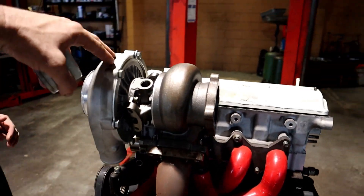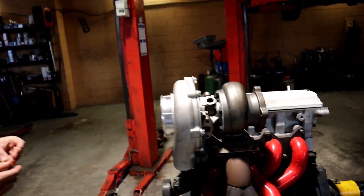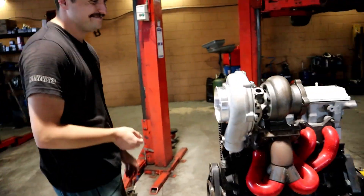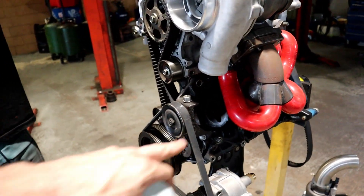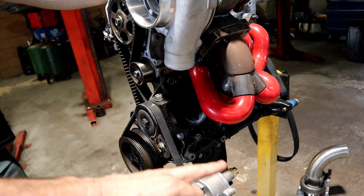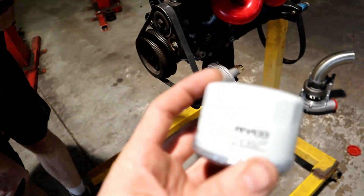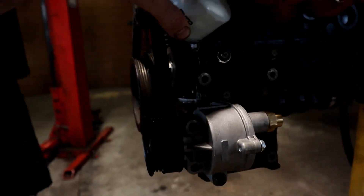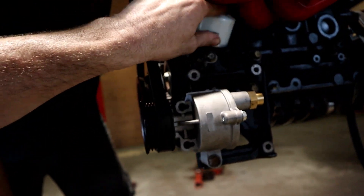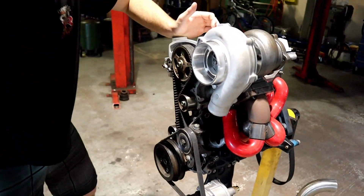This is the manifold that we slapped together with the Lego a few months ago, and this was pretty much what we wanted to do. With this setup it still fits with the stock radiator as well. We were happy with it and planned to put it on Nick's car, but when we test fitted it and tried to shut the bonnet, it hits the bonnet. Before we even started making the manifold, I realised I didn't have the relocator for the oil filter, and because Nick's running air conditioning there's not really any room for a relocator anyway. I came across this half-size oil filter, the Z1082, which is half the size of a Z386, and it fouls on the manifold — which means we have to scrap this whole manifold design and start again.